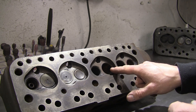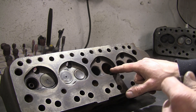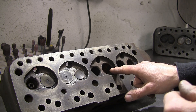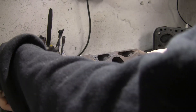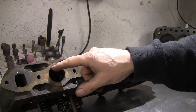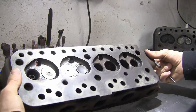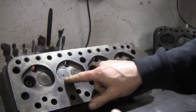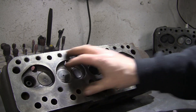The 202 has a 29.36mm inlet and the stock small bore heads — 4810 etc. — have a 26.9mm inlet valve. But also, the 295 casting has far superior porting to the others: a much more open design with minimal guide boss, a larger inlet valve, and the superior chamber design. As far as flow potential goes, the 295 has a lot of the work already done for you over the other heads.